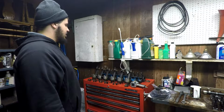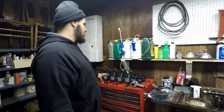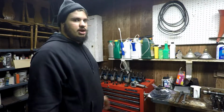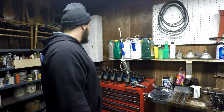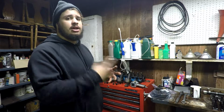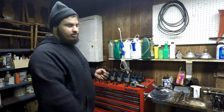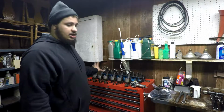That, on top of the fact that one of the valves in here, I'm not going to roll it over, I don't want to mess stuff up. I'll show you later when I take it to a machine shop. But one of the exhaust valves is leaking, so there was oil getting in through there. It was that number 5 cylinder. And that exhaust valve was leaking real bad, and so there was a lot of oil in there. And the intake valve on cylinder 1 was also white, which apparently means that it was getting really hot in there. So maybe there was some fuel burning up through the valve before it closed or something. I don't know how that works, but it was white. So yeah, it was getting hot in there.